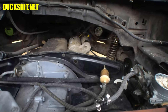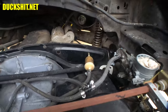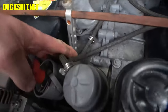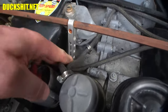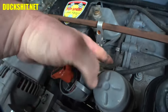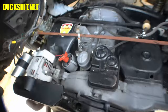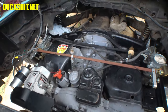That old filter still needs to come out and I need to put a little junction in there to couple the two lines together. I also have to work on this fuel line to stop it from getting into the throttle linkage — that's dangerous, it's just wearing on it. I think I could probably prop this stuff out of the way. Look at that — see how simple that was? I'll just put a little zip tie on it to make sure it stays there, but that solves the problem.